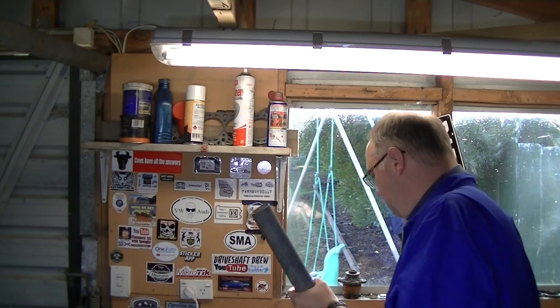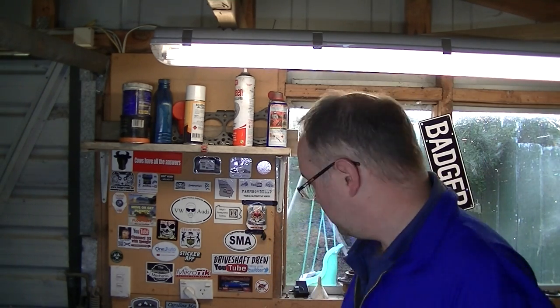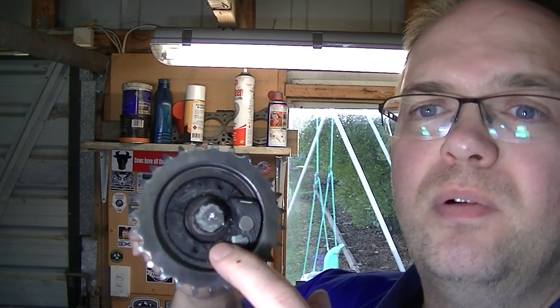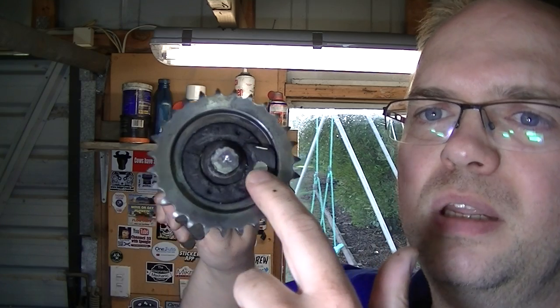So that didn't work. What I did was I took this down to my friendly machine shop, and we ended up having to try and heat it up — but the bolt was still stuck. And in heating it up, they've also kind of destroyed this camshaft sensor. It's a Hall Effect sensor that sits on this camshaft here.